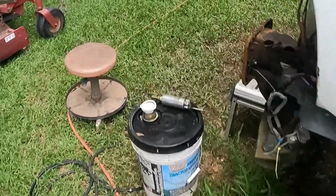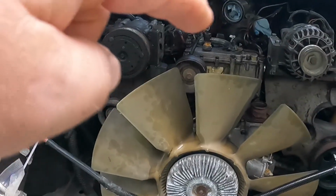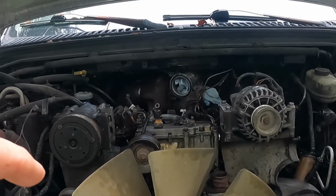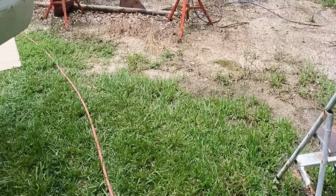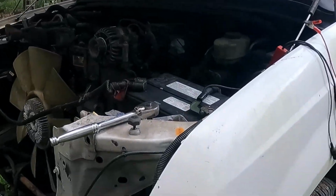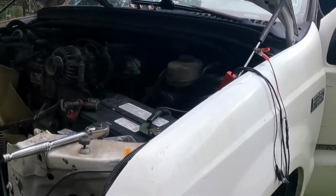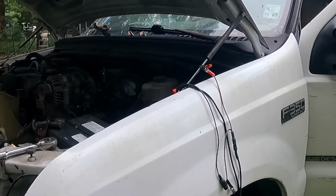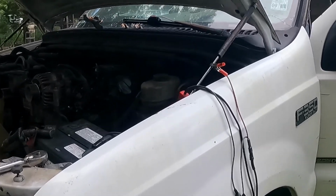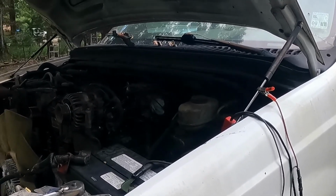And in coming up here to check to see if we were dripping, I noticed we weren't dripping right here from our drip tube, but we were leaking from where the drip tube originates from the back of the fuel bowl. So it's all in the valley and it was all dripping all over. So we're primed now, and I'm still leaking from the fuel cap. I had a fuel filter, but the wrong style. So I'm gonna go grab a fuel filter and put it in here and see if we can seal that up and decide whether or not it's just the ball valve for the drain that was leaking all in the valley, or if we got some other stuff going on with the fuel bowl and we need to do a reseal with it. So let me grab a fuel filter and then we can try and see what kind of fuel pressure we're seeing.